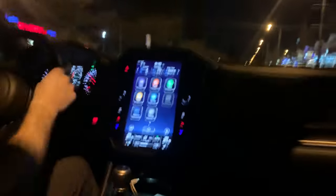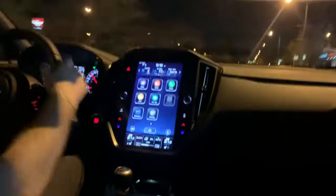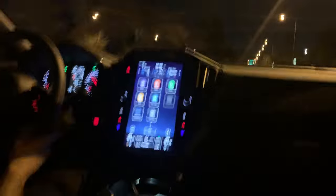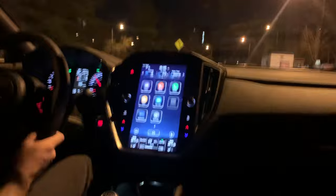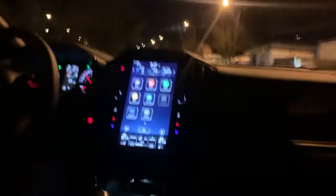Alright, we're at 68 degrees so we can have some fun. I want to mention that I've bought the Accessport — the Cobb Accessport — for this car. I'm trying to keep everything very conservative as far as extra power goes. So far I've done the ETS axle-back and a Stage 1 off-the-shelf tune via the Accessport — not even the 93 tune, just the 91 octane map. The car feels amazing now. It really feels like STI-level power, and even better at lower RPM. Peak boost is now at 15.3 PSI versus 12.5–12.6, so about 3 PSI more — roughly 20% — and it definitely feels 20–25% more powerful.